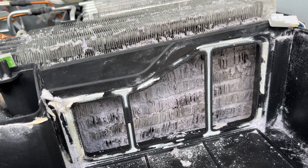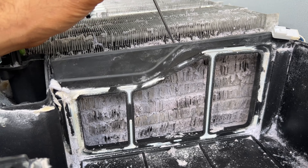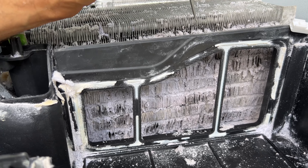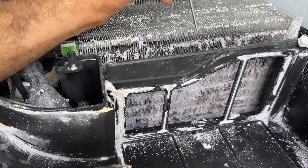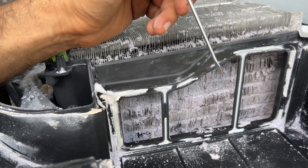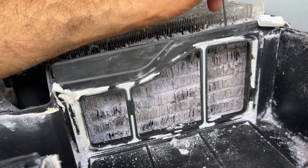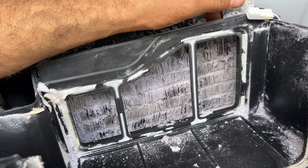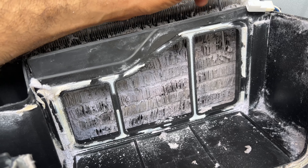Here's the fun part — when you open this area apart it can take one to two hours to clean all of this. Because if you use an air compressor even from the back of these coils, it will blow some of the stuff from the front but it will not completely clean it. So you really have to get a small flat screwdriver and start cleaning it like this. You want to be very careful — do not pinch anything. If you want to use a vacuum at the same time, you can — it's helpful.